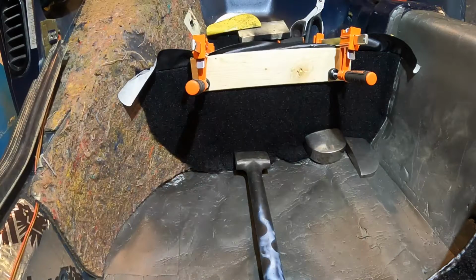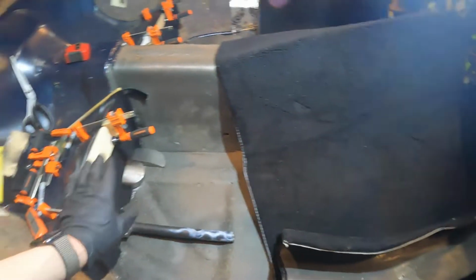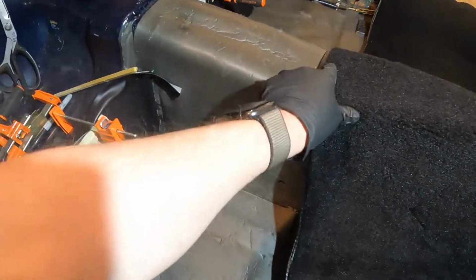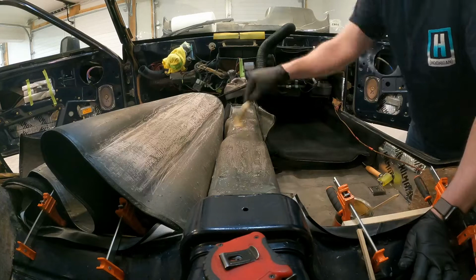And that's that. We got that in, that hardened up. We're gonna take this carpet. Once this is all dried up in about 30 minutes, we're gonna take this carpet. I made 2 center marks here to match a line here and same on the other side. And once we do all that, I'm gonna fold the carpet in half. We're gonna lay glue and I'm gonna bring the carpet towards the outside. Really trying to get into every crevice and nook and cranny and going from center out on both sides.